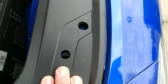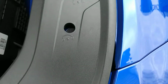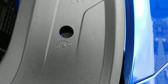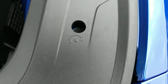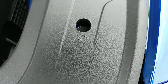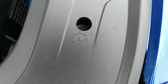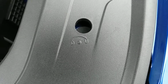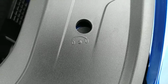That's where I learned about the screwdriver trick and also that nut on the bottom for how to adjust these headlights. I'm not quite sure why the low beam is adjusted so low from the factory, but it's adjusted very low. I mean, into the ground low. And visibility is terrible, not because the headlights are bad, they're just pointed too low. Now, you don't want to raise your headlights up so far that you're blinding people. If you're getting flashed, you need to lower your headlights back. Don't be that person that blinds people. No one likes that guy.